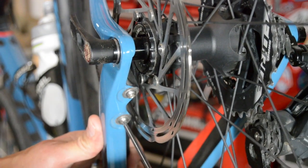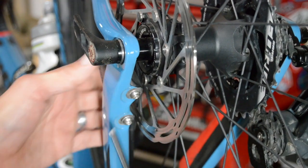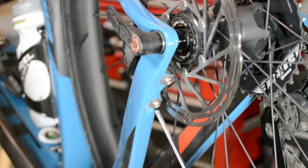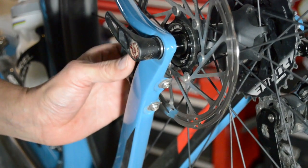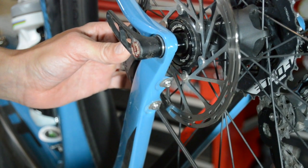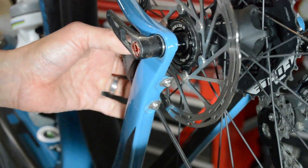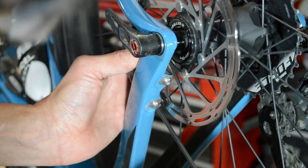This is a flat mount style, so the bolts will be underneath the frame, or on the front side of the fork if you're doing this on the fork. Basically just get that to where it's loose. Usually what I'll do is squeeze the lever in and then snug the bolts just lightly down at that point, and see where that gets us — usually that gets you in the ballpark. If you visually look down at it, you can see the rotor between the pads; I usually like to put a bright-colored background on the bottom where you can kind of see through. Once you get it lined up, just gradually cinch each bolt down back and forth — don't tighten any one side too much, that's a mistake a lot of folks make and it twists the caliper. As you can see, we've got it centered there between the pads.